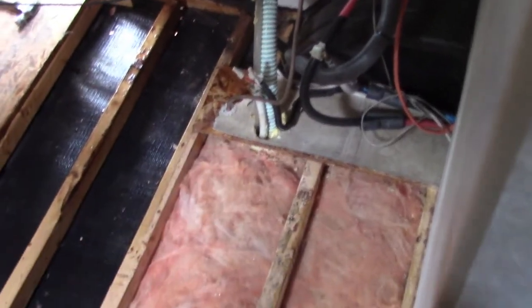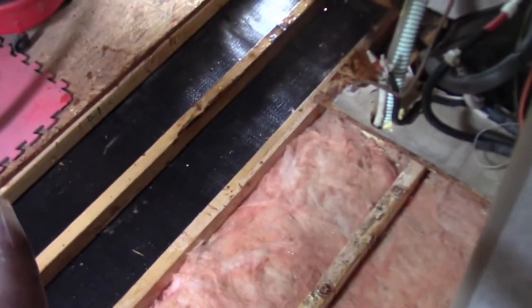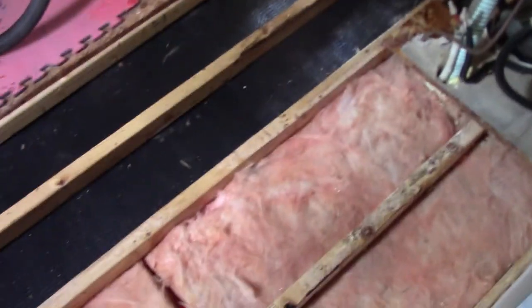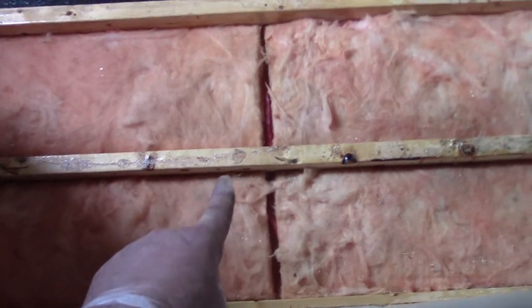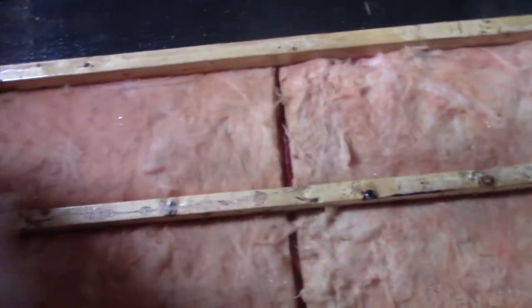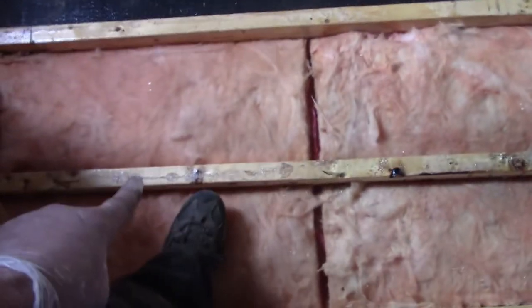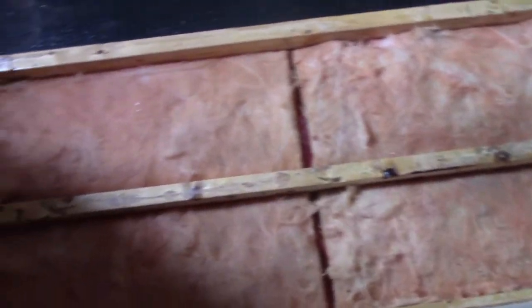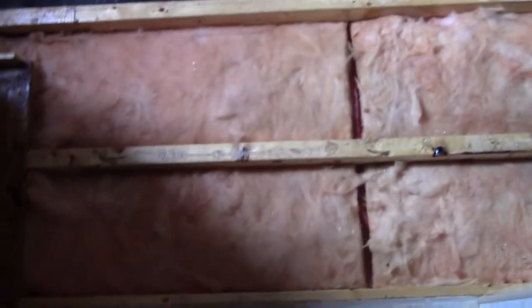The area over there is going to be completely encapsulated in a storage cabinet the height of the bed, from the back of the trailer all the way forward. The half inch is going to end right where the cabinet begins, and then the three-quarter flooring will come flush with the beginning of the cabinet. So when you put the flooring down, you won't even know it. The other thing it's allowing me to do is put more cross members where the tires are going to sit and support the flooring as best it can be. Right under here, which is where the front tire of the motorcycle and the front tires of the four-wheeler will go, there's a metal cross member already that the wooden cross member is going to be carriage-bolted through. There were three carriage bolts in there — I took them out and I can access them from underneath.